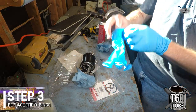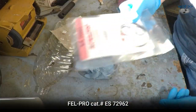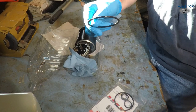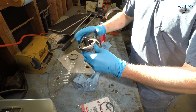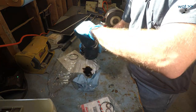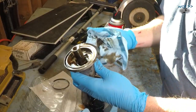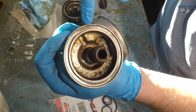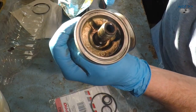Now that that step's completed, I've brought it over to the workbench. First off, make sure you have a gasket kit. Take your old gaskets and make sure they actually line up size-wise — and this one does. I don't know if that one started life rectangular, because it's supposed to be a circular O-ring. See how hard and brittle that is — it's no wonder this thing's leaking. There are a couple spots where you can see oil baked in underneath where the ring should be. That should be stopping the oil from getting through, so that's probably where it's been seeping.